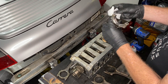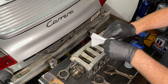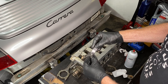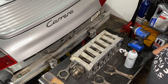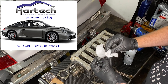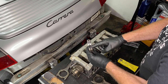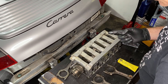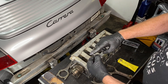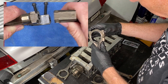Same as before — the scotch-brite pad with the spray to begin with, then following up with the KimTech wipes. The wider big end bearings from Hartek — even though they're new, I'm giving them a cleanup. They seem to have an anti-corrosion coating on them but they polish up nicely with just the KimTech wipes, no abrasion. As we spoke about before, these wider big end bearings from Hartek are designed to fix a known problem on these engines: excessive wear in those big end bearings. Now that the bearings and conrod caps are clean, we're putting Graphogen on them, going really close to the edge but not over it — we don't want anything between the bearings. The ARP bolts get ARP lubricant on them so nothing hinders their rotation and you get an accurate torque reading.